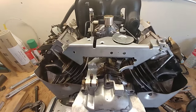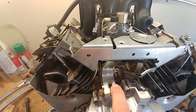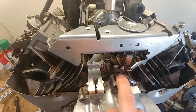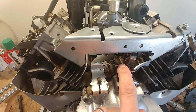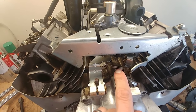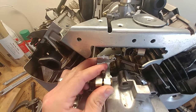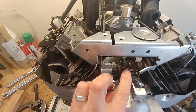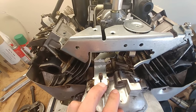Another confusing piece is what all these springs are called. This one down here, connected between the governor arm and the base plate, is called your governed idle spring — not your governor spring; the terms get used interchangeably. You can get different color springs with a paint band, and some for the other one, that change the speed your engine idles at. When you have no throttle, this spring is the only thing holding your governor arm and controlling your throttle.